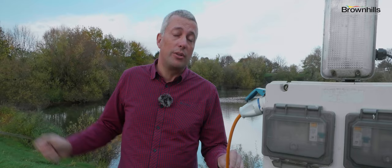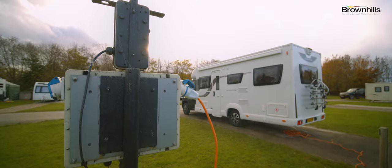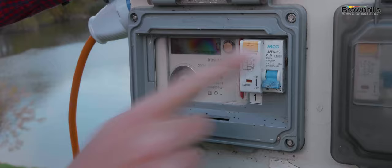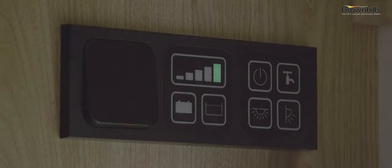This pitch is quite close to the motorhome, but on some foreign pitches — particularly Dutch pitches — it can be miles away. So it's always a good idea to have a long mains hookup cable. If you haven't got mains electricity in your van, the first thing to check is the trip switch on the electric hookup bollard — check it hasn't tripped out. This one has a test button. If there's a nought showing, just flick it up and you should get power in your motorhome.